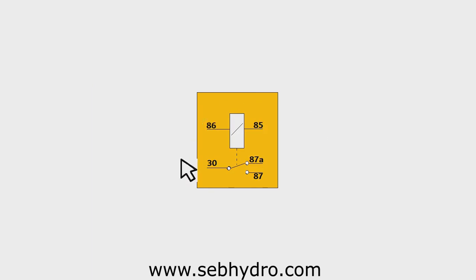Specificity related to the pinout. Relays can have 4 or 5 pins: terminal 86 is the coil input (plus), terminal 85 is the coil output, terminal 30 is the contact input common, terminal 87 is the normally open (NO) contact output, and terminal 87A is the normally closed (NC) contact output.